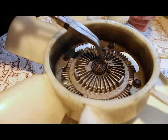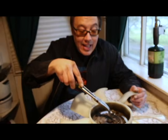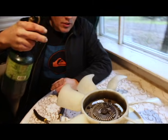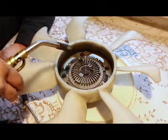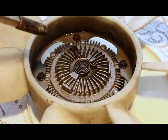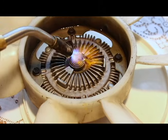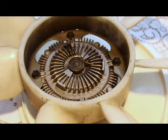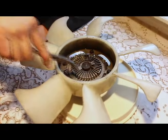You would be surprised at how much mileage you lose if this is engaged all the time, and how hot your car gets if it does not engage. I'm going to show you with this propane torch — don't do this at home because you might fry your fan clutch, but it's okay for instructional purposes. I'm going to heat this up and you're going to watch this spring rotate counterclockwise. So that spring rotated counterclockwise, turned the valve, and it's telling this to engage.